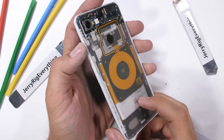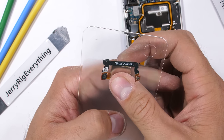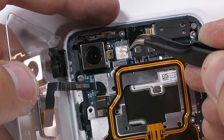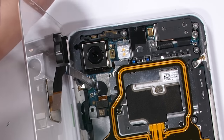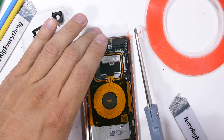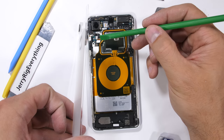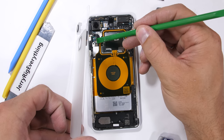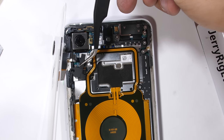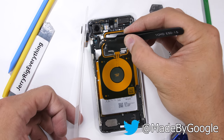It would be nice to see the vibrator though. I'll give the glass one last cleaning and place the fingerprint scanner back into its hole along with the singular circle camera lens. The flash diffuser is a bit harder to place now that the coloring is gone, so I'll rest it sticky side up over the LEDs so it'll stick to the glass in the correct spot when I set it down for the final time. I'll lay down some clear double-sided tape around the edges of the phone. The Pixel 3 won't be water resistant anymore, but for aesthetics as eye-catching as this, it might be a worthwhile trade-off. Google could totally manufacture a clear watertight version of this phone with basically no changes to the internals — just a clear piece of glass and clear adhesive and they're good to go. If only there was some way to contact them to ask for it.